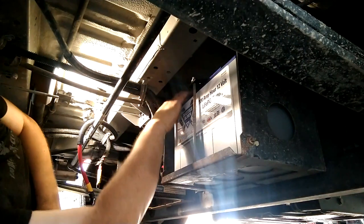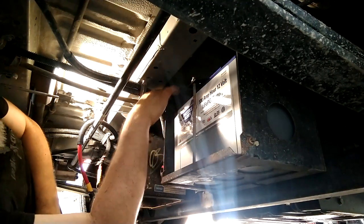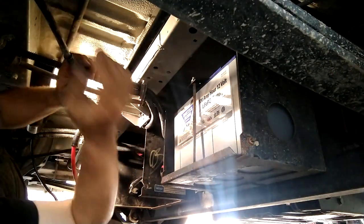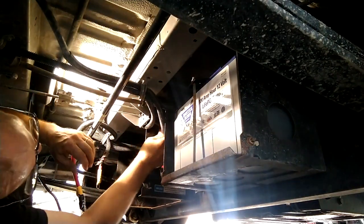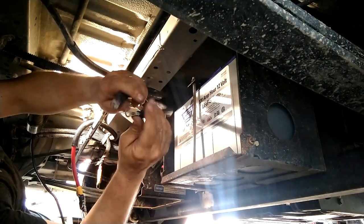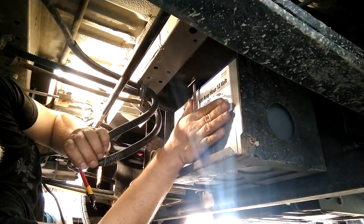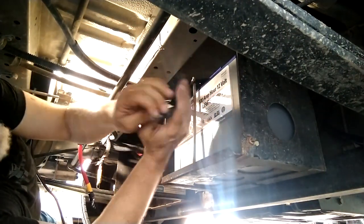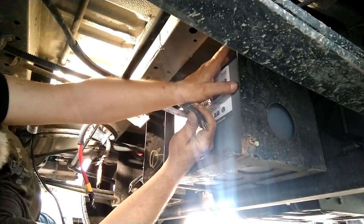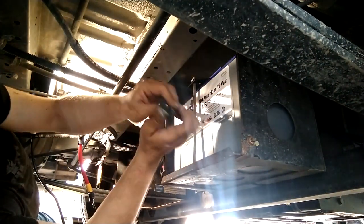We have our bolts already on the connection points of the battery. When we have our cable, we put those back in place the same way they were before — or with any changes needed for the lithium system rewiring. If you're just swapping the batteries and doing no other changes, connect the same cables to the same positive and minus terminals you had before. Don't forget any of them — count them when you take them off so when you put them back on you've got the right count.